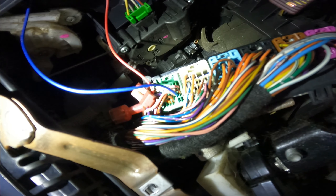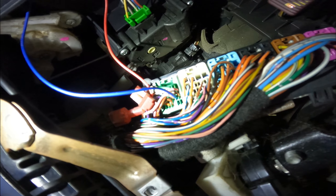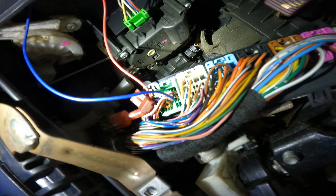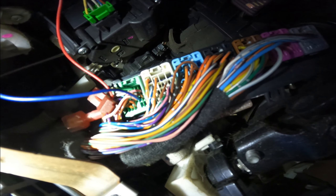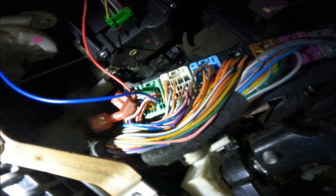We got her in — the primary lock is back in, and the green connector is reconnected back into the body control module. I'm going to go back to working with my head upright. I'm not going to put the HVAC box back in yet, because if I have a problem I'd rather troubleshoot without that box in there. All we've got left to do is hook up our ground wire and we're good to go.